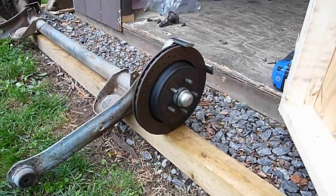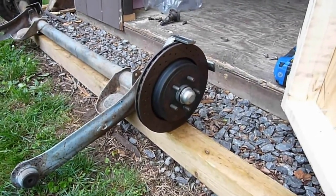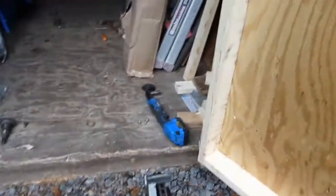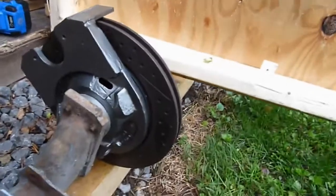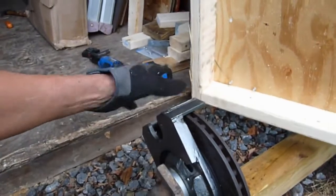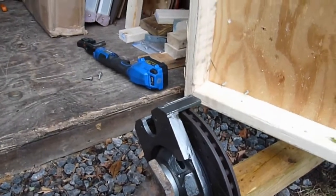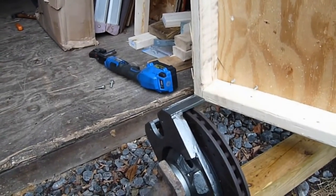For anyone who's wanted to do a big brake conversion for the rear of the Lasers and Daytonas, especially if you've got drum brakes, this setup is one that I made from the smaller size — 10 and a quarter inch I think it is. I put the big 11 inch rotors on, so I made this bracket with ears and then the big rotor caliper goes on these ears. That was a setup that I had done that works pretty good. I don't have any problems with it, but I got thinking.